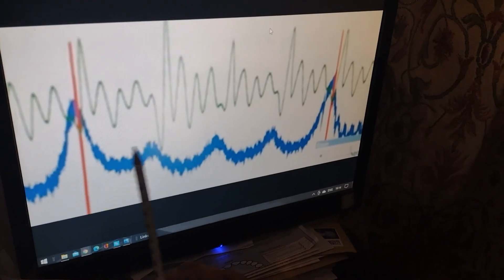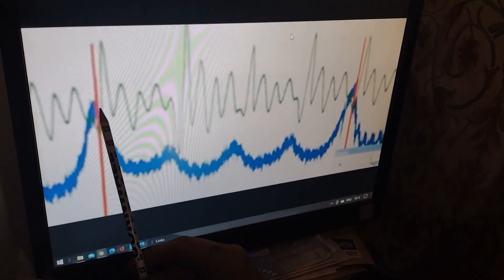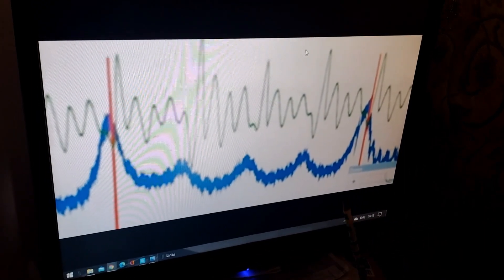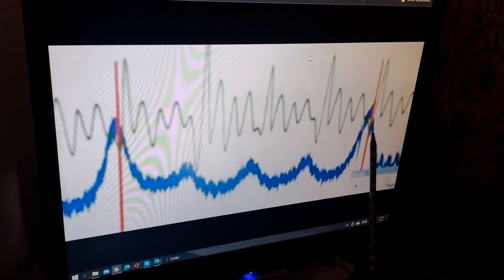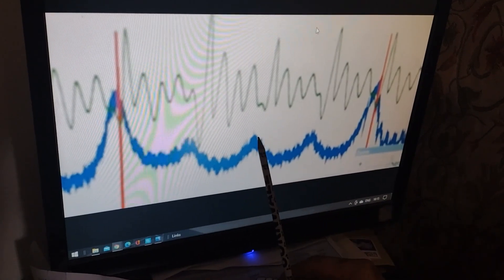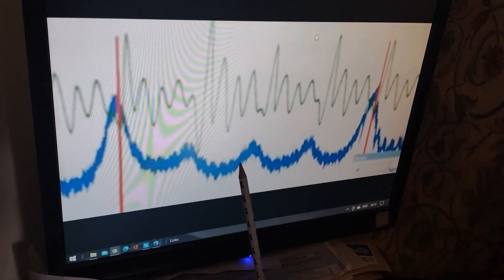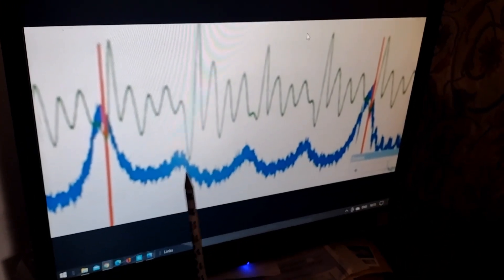Here's the waveform from the other day, zoomed in a little bit. The blue one is the relative compression — that's cylinder three on the diesel injector — and cylinder three firing again as it goes through the cylinders. We know the firing order is 1-3-4-2. The green one is the exhaust. We know the problem was cylinder one had a really bad exhaust leak, and cylinder four was also leaking but only on one valve and not as bad.